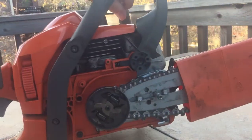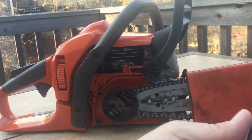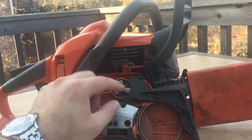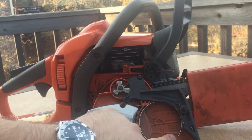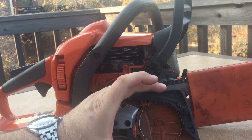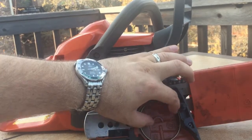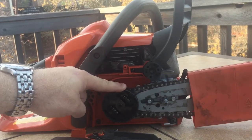Here's the real issue. The clutch cover is missing — here it is. When I popped this off, the knee joint right here had rotated up. When it rotated up, a spring inside relaxes and allows this clutch brake — this piece of metal — to contract. The spring relaxes, pulls it in, which reduces the length of this piece, making it so small it can't get back over the drive.